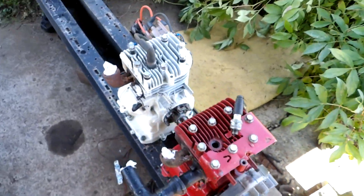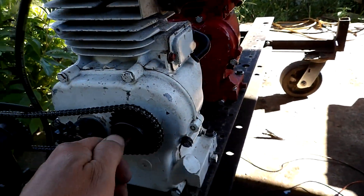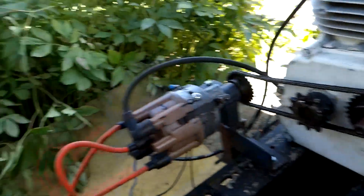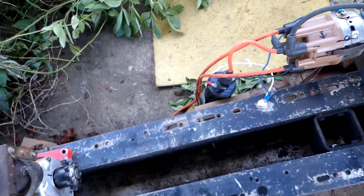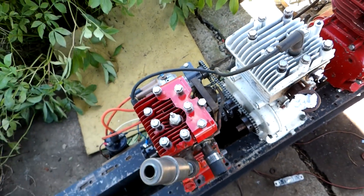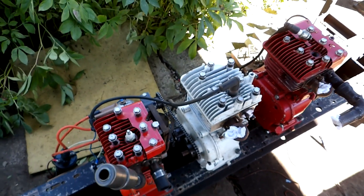Before this gets too long — that's my ignition system. Here's my chain — drives off a camshaft at half engine speed directly to the distributor. Now I attach cylinder number three, get him up here and get his connector link chain on there and all that. Continue on, then goes the intake manifold and gas tank. All that's fun stuff.